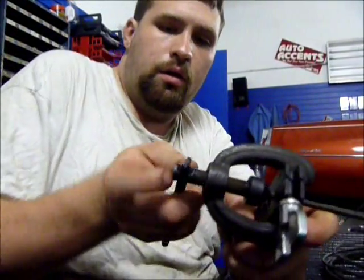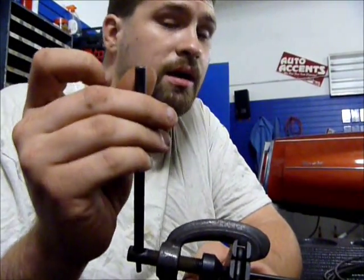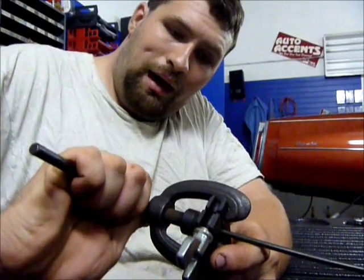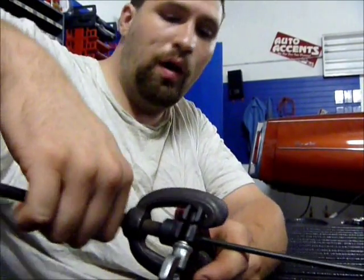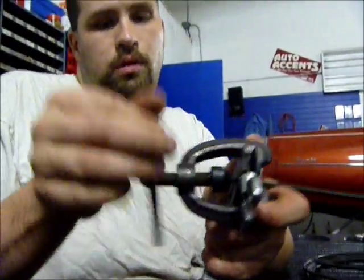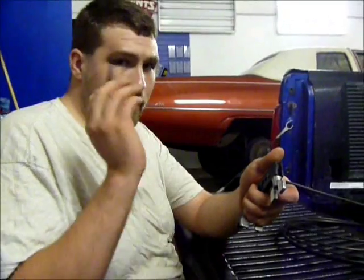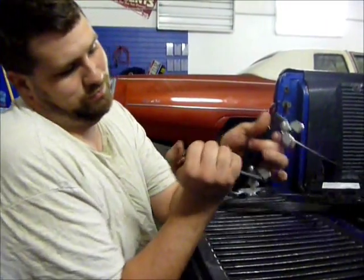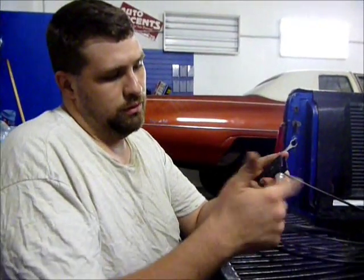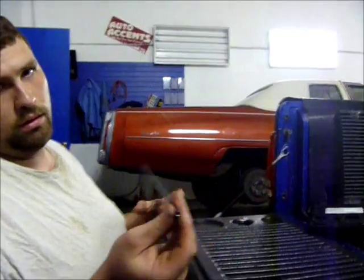Once the press and chuck have been removed, you're going to take your press once again and run the cone directly down on the center of your single flare. Take your bar and tighten down. At this point, you don't need to go very hard because you can actually damage your flare. You're going to run it down until you start getting a good amount of resistance. Once you've done that, loosen your press and remove the press completely. You'll probably need to use your bar to loosen the actual block, since if it's nice and tight it's not going to release very easily. Take the wing nuts down and remove.